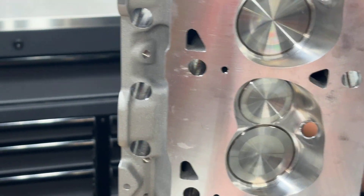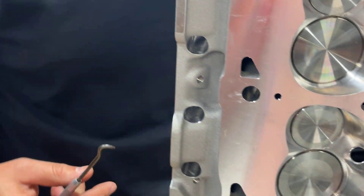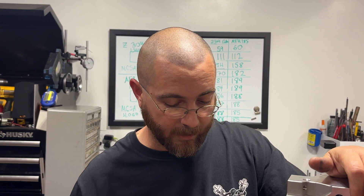Last I checked, it's very similar to the old Canfield small block Ford heads, which are pretty popular. With a lot of work, they will flow pretty decent — I actually had a set last year that flowed about 296 at about 650 lift. Anyway, those are the pros and cons on the cylinder head. The truth is these are $1,700 — not for the pair, $1,700 each, so $3,400 for a pair.